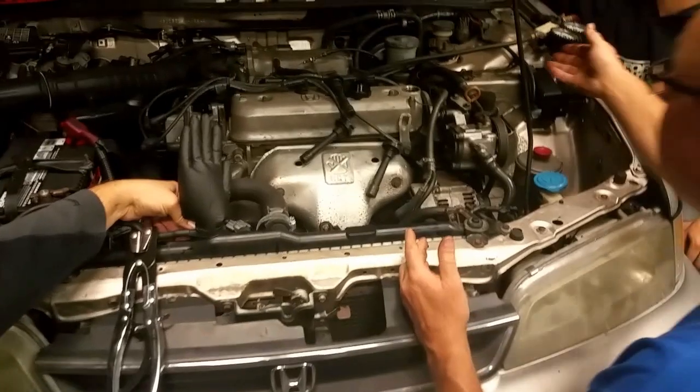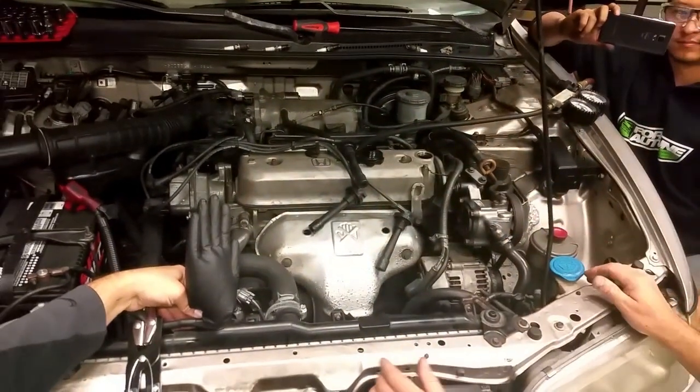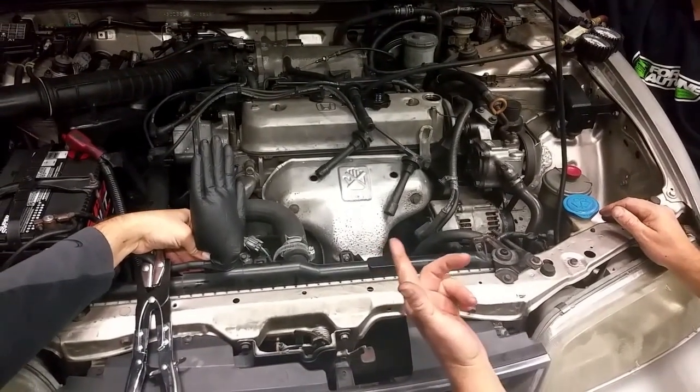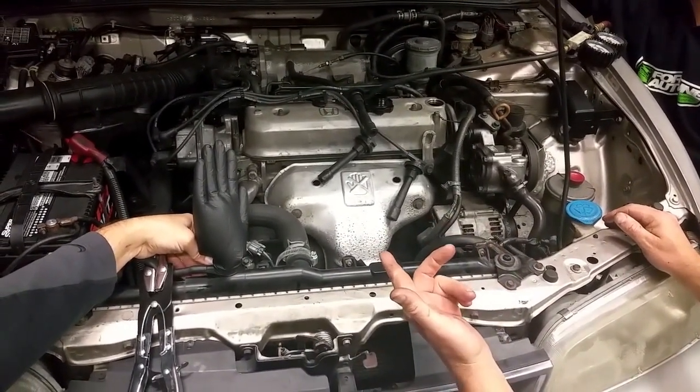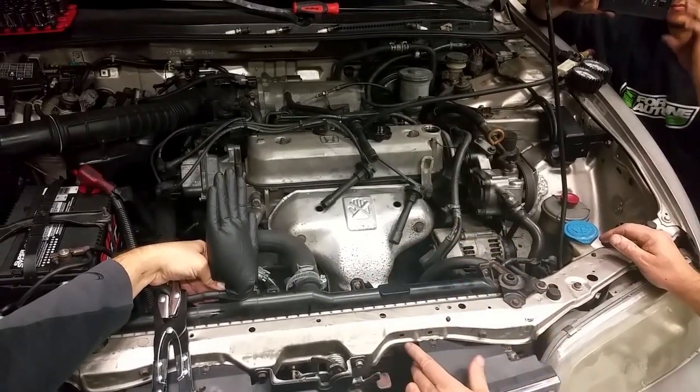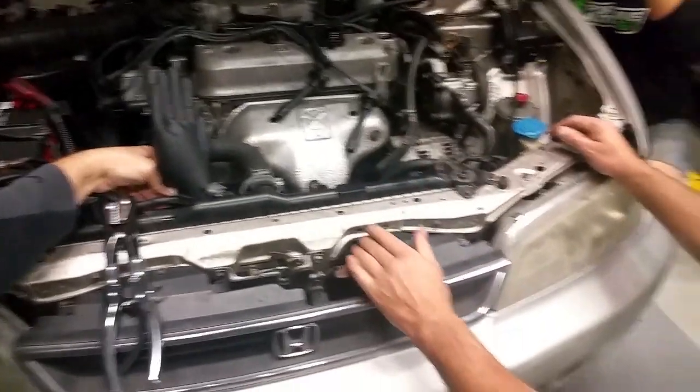...it is indicative that I'm actually increasing pressure in the cooling system. The only way that's going to happen is because of either a cracked cylinder head or a leaking head gasket. Or in a very rare case, maybe something with the combustion chamber, but more than likely it's a cracked cylinder head or leaking head gasket.